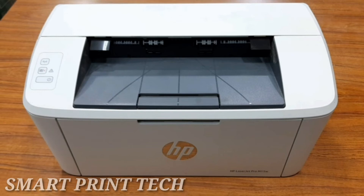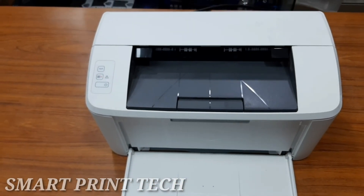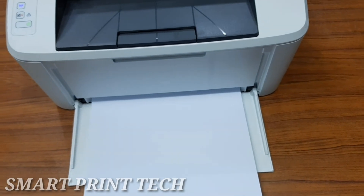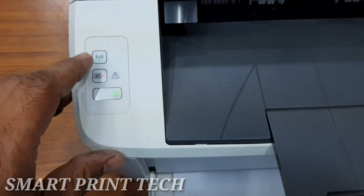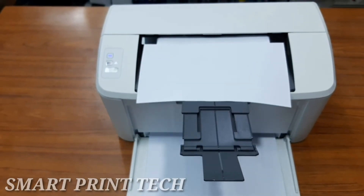When the attention and ready lights are blinking, the printer is initializing, cleaning, or cooling down. During cool-down, print jobs may pause but will continue when the engine is ready — this might take several minutes. To take a test print, press the power button, open the input paper tray, and insert some blank paper. Press and hold the resume button, and it will produce a configuration report as a test print.